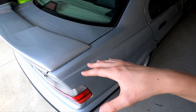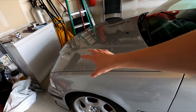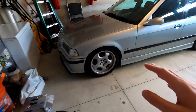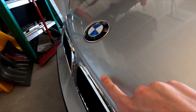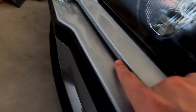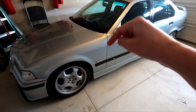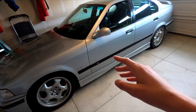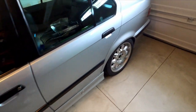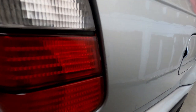I'm going to go around the rest of the car and do this, but this should give you the general idea of how to touch up your car. It is a new day — I wanted to let the paint sit for at least 24 hours to cure. I could not be happier: you can't even see them. I left one with just Rustoleum on it and did not put color-matched paint over it — if you have an arctic silver BMW, I'll link the Rustoleum in the description below, it's almost a perfect match. Over here on the door you can't even notice it, and around back you wouldn't even know.